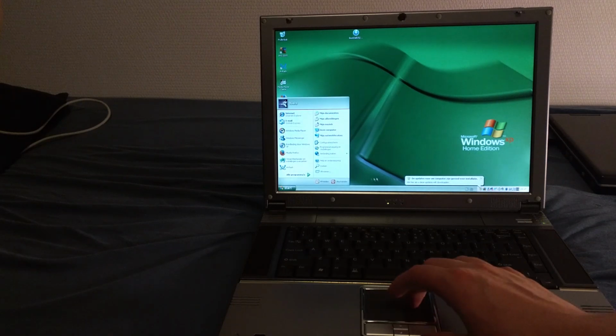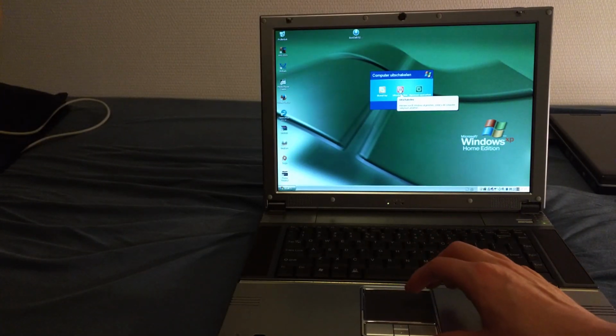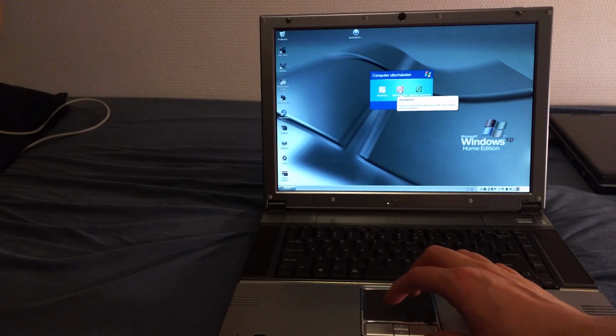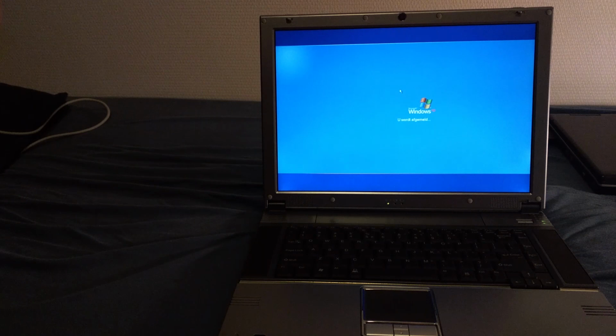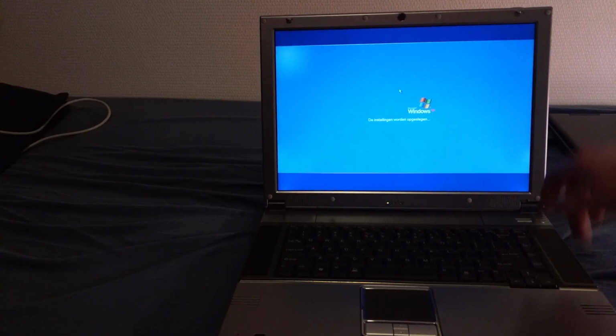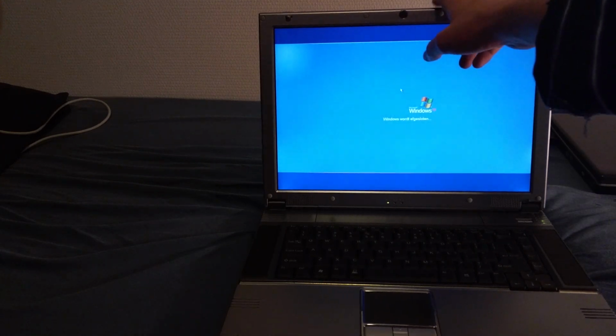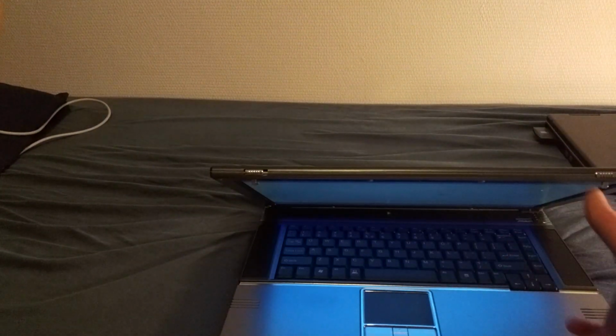Not much else on there. This laptop is fully SIS based, has SIS onboard video, which sucks. It's 672 MX or something like that. SIS 900 Ethernet, which is sort of okay. At least it has PXE boot and Wake-on-LAN capabilities. But yeah, it's really, really basic. And it's just a piece of generic crap in my book.